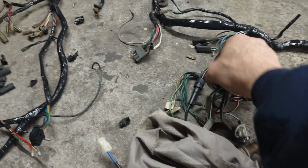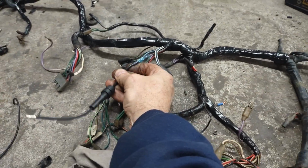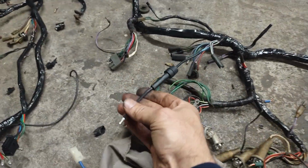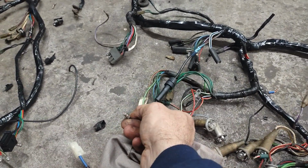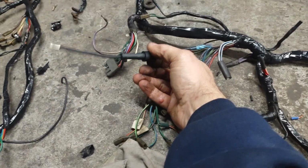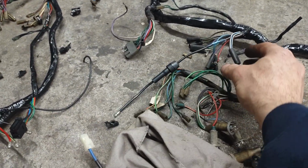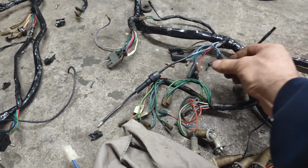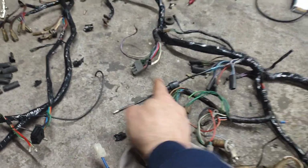The headlight steering column switch comes off the ignition switch from the amp gauge to the headlight switch, which is not actually fused. There is no fuse on the headlights, which I had a customer after VTR drive home and his harness fried because the dimmer switch to the headlight column shorted and melted it. I was able to save it, but an inline fuse for the headlights is a must.